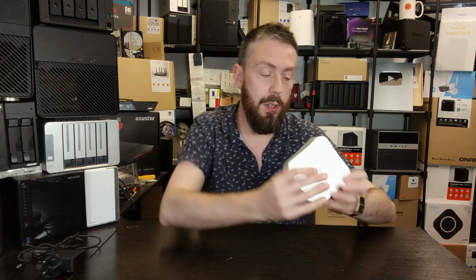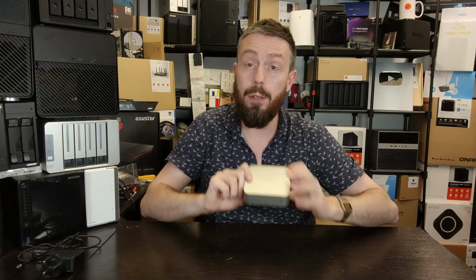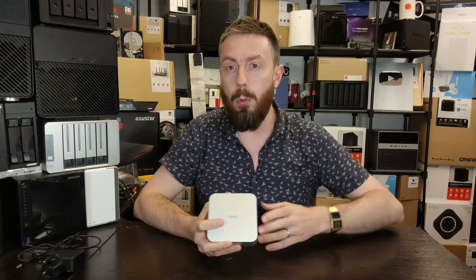But I will hold them to account for, it's probably one of the earliest disappointments about this device, and that was the single Ethernet port there. Let's be honest. If you're going to run a NAS, you want one of two things. You want great internal performance and you want great external performance. We've already talked about a number of different flash NAS systems over the last few weeks where we have talked about them really pumping the performance of M.2 NVMe drives inside and the external connectivity either limiting you to 2.5 GbE, limiting to 5 GbE, 10 GbE, or just going whole hog and giving you loads.